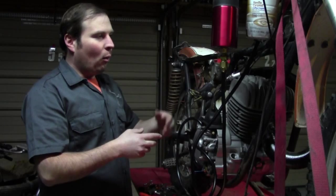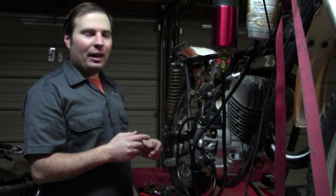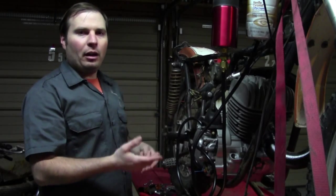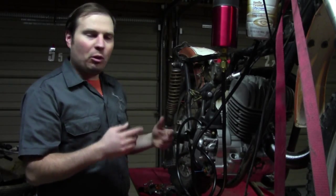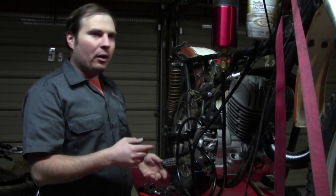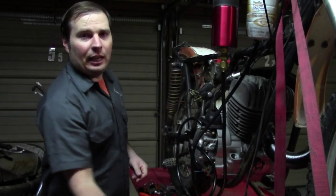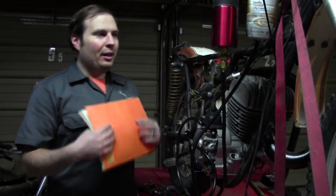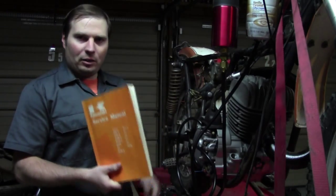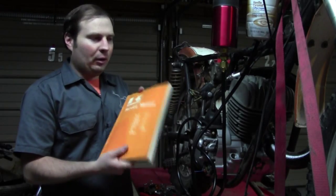I suspect, because of the age of the bike, that the exciter and signal coils on the magneto are faulty or became faulty — or they were just within spec enough to give spark and run long enough to vibrate some rust or corrosion loose, and now I either have a dead short or an open. We're going to diagnose this, and this is the part of restoration where, like I said a few episodes back, you really need the service manual.